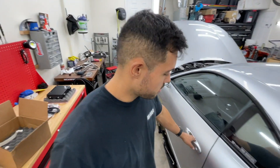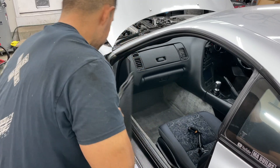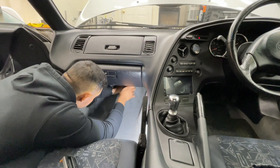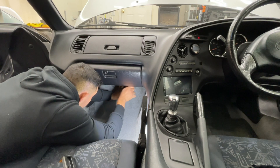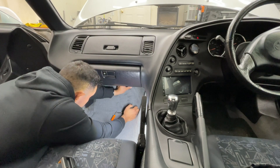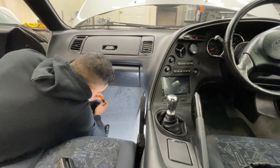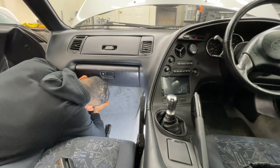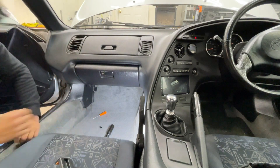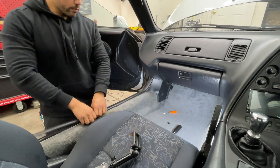The old one is located here on the passenger side. Pull back the carpets, so it's pretty easy to take this off here. Just got a couple Phillips screws. As you twist, you have to hold the outer and you'll see it kind of pop up a little bit. Stick something underneath, pull that out and it'll just come right out. This one's got a little barb in here - you just push that in. All you have to do is pull this up here, start from the back and then work your way forward.